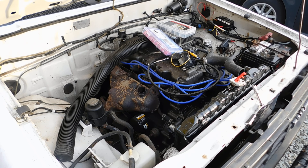Got the hose cutter 9000 on there, then we're going to fill this with water. I think we'll start it up. Curious if this thing will even start. The overflow is empty. The battery's charging but something is wrong — I checked when I put all the electronics together that the fuel pump functioned, and I am not getting the fuel pump. I'm not getting any in-cab power, so I'm also not getting any dash lights.